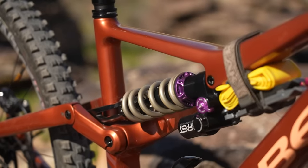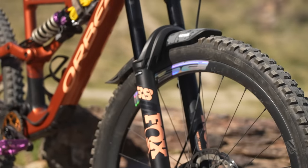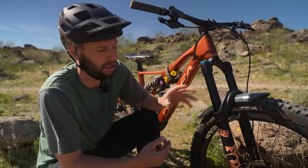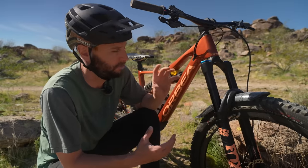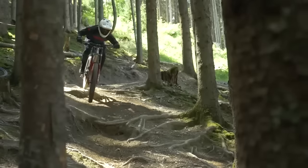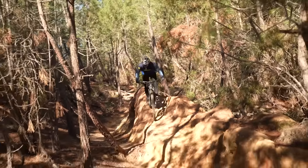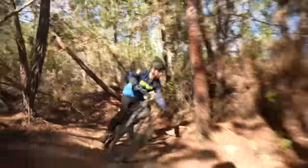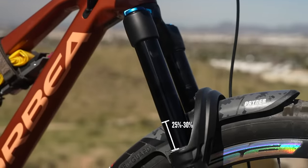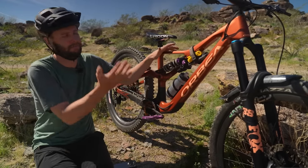Now we're onto suspension — a humongous topic in itself. Enduro bikes typically run 160, 170, maybe up to 180mm of front travel — big, burly things. It's how these bikes are set up and how the suspension works that's done differently in enduro. Downhill suspension is rock solid — high speeds, big impacts — with sag around 15 to 20%. The sag on an enduro bike is going to be a little bit more. Riders actually set up their bikes a touch softer because they're doing a lot of stuff blind and don't know what they're going to hit. Sag could be 25 to 30% on a lot of pros' bikes. I run mine at about 25%, and it ramps up quite firmly.